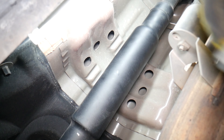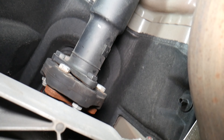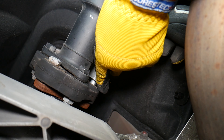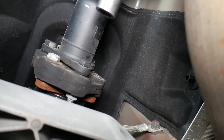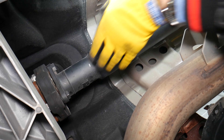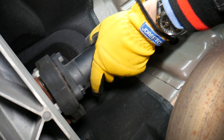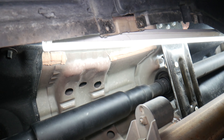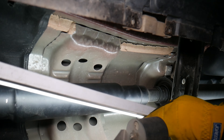Get it loose — that's the first bolt. We need two more. Remember the position of the bolts for reinstallation. The guibo nuts face the front side of the vehicle. Be careful not to drop anything on your face. The guibo came out. If you're just replacing the guibo, you're done — just unscrew and replace. But we'll be removing the whole driveshaft to replace the driveshaft bearing.